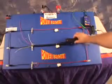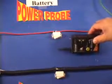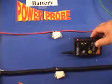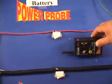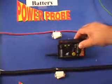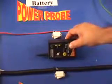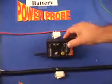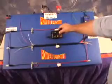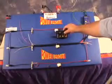Slowly lower the receiver onto the main circuit that has the signal lead connected to it. As you can see, the receiver detects the open circuit signal about 2 inches away. Now, keep the receiver at this distance and then trace the circuit. It's here at the open switch where we lose the signal. Holding the smart receiver at a constant distance from the transmitting circuit while you're tracing is the recommended way to keep you on track, as well as knowing a weak signal from a strong signal.